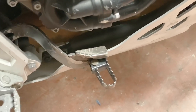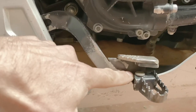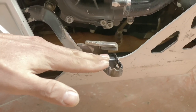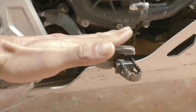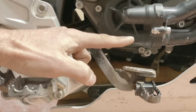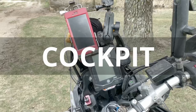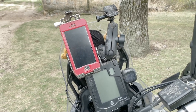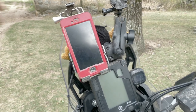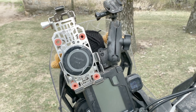One little detail I did for the rally was a dual-height brake lever: I welded a piece of steel onto the brake lever so I have one position for sitting — foot at a slight angle — and one for standing, where the boot sits higher. That way braking was comfortable in both positions. It may surprise people, but I think one of the most important changes I made for the rally was the cockpit — this mount from LSADV.cz from Laosh, who was also racing, is an absolutely amazing piece of kit.